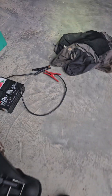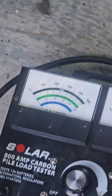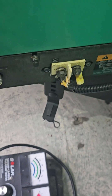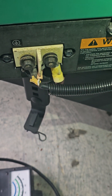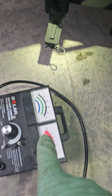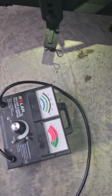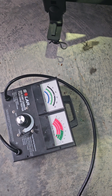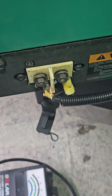One final tip: it's really good to use a big old-school carbon pile load tester on the battery points, because a lot of times you'll get voltage that appears healthy but under load it will plummet. Voltage and amperage are not linear — they're not directly connected. Most people think they are, but they're not. So even if you have healthy voltage, you've got to check it under load. This battery passed that test.